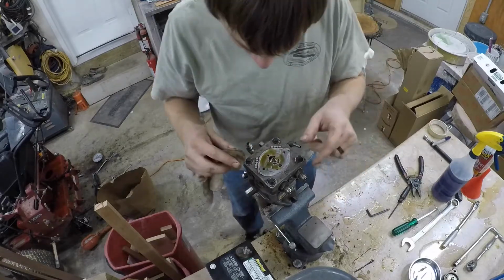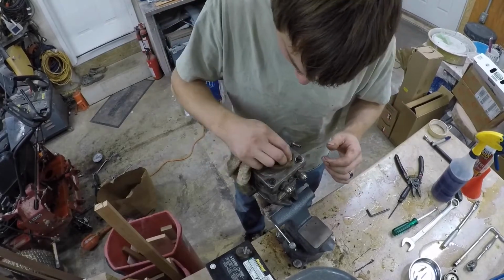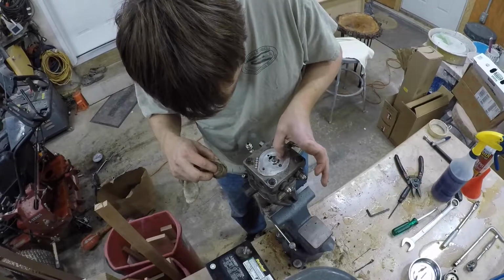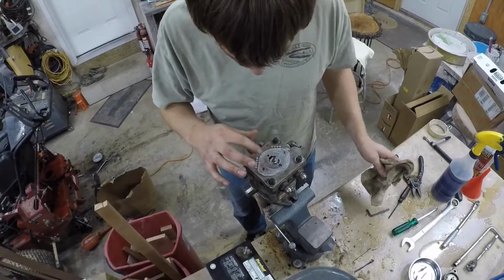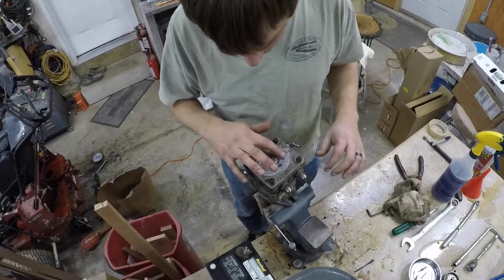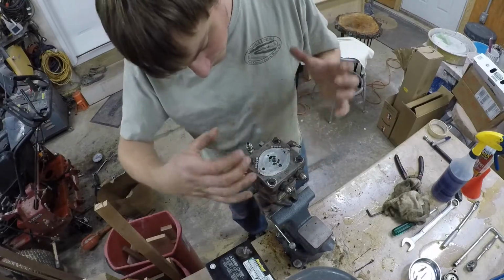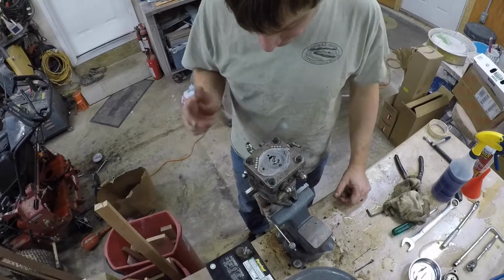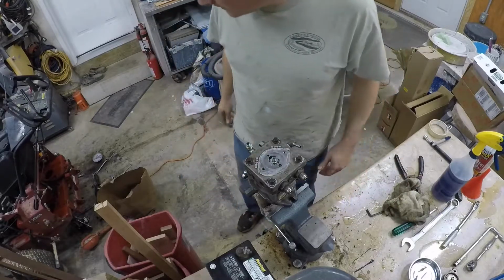So that's what was the problem on that other pump: it was all eaten into the case up here, into the aluminum. This one, there's nothing I can catch with my finger, so we're going to just leave that one, call it okay, put new seals in it, be good. The other one is all eaten into the pump, and there's some scoring on that rotor, so the housing and the pump are both junk. That kind of sucks, but it is what it is.